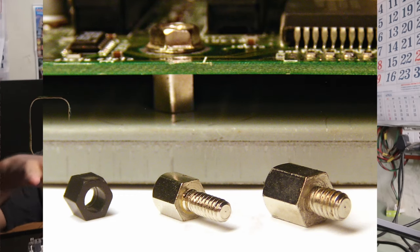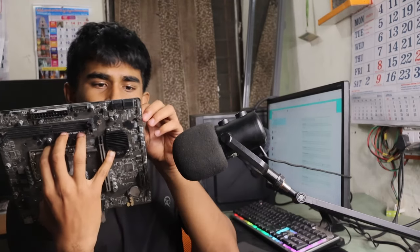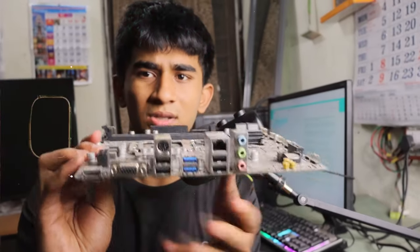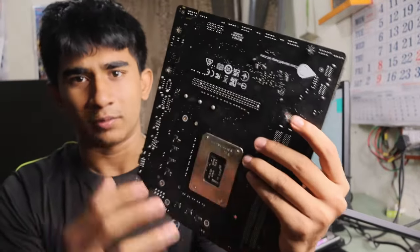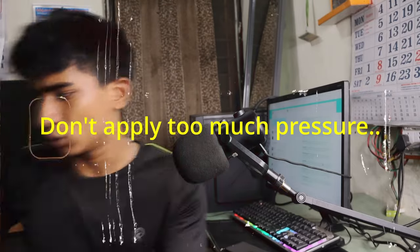When you are fitting the motherboard into the case, don't apply too much pressure while fitting the screws, because it can literally bend your motherboard. The motherboard should be completely flat — when you apply too much pressure, you can see a slight bend which will break all the pins behind it. Avoid applying too much pressure while assembling your PC. I'll demonstrate: place your motherboard on the motherboard box while assembling.